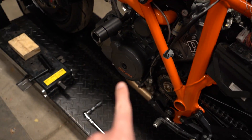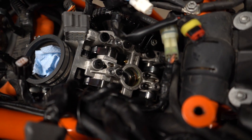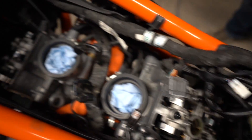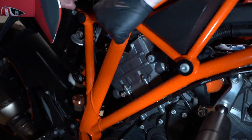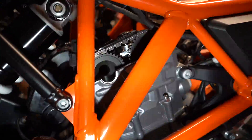We're turning the engine to go to top dead center, doing the rear cylinder first, and then we'll take some measurements. You put the feeler gauge in between here and here. It's a lot — it's an experience for sure to really get the feel. I've gotta get both dots lined up for TDC.